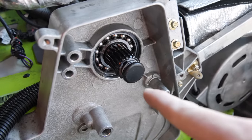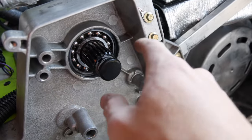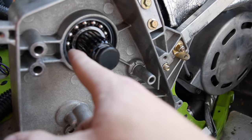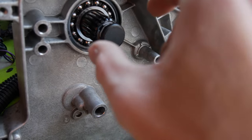Next, once you get the chain and the snap rings off, along with the gears, you're going to want to heat up this case with a heat gun. Make sure to just heat up the outside — that will expand the case and not the bearing. Then once you get it heated up, you can take two screws and pull that bearing out.